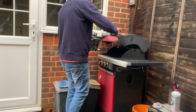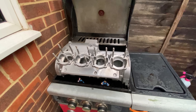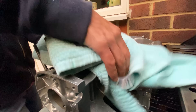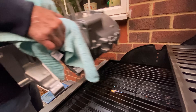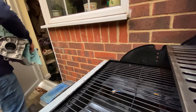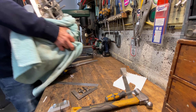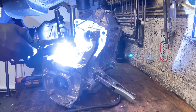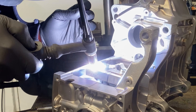I pick up the crankcases and take them outside to my barbecue to heat them up — this helps the welding process. After about half an hour the crankcases are really hot, and I've lost my heatproof gloves, so I grab an old towel to stop burning my hands. I get straight on with the welding to weld the two blocks in place while the crankcases are still really hot.